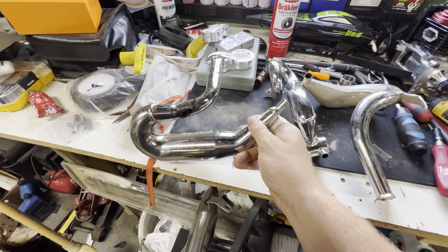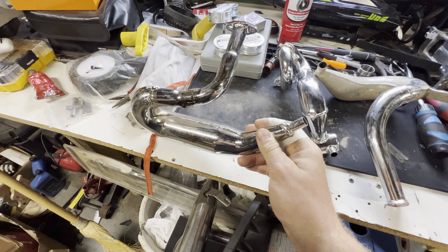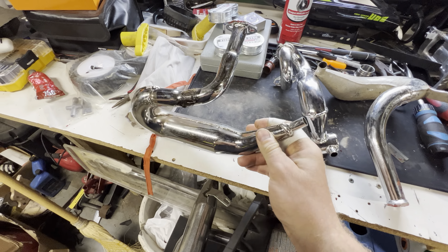With the smaller small bore engines, I like the Dominator V1. If you look at the stinger, it has a nice tight stinger on it — I feel that helps with the smaller bores. If you get this Dominator pipe, I think they sell something to raise the cage, because if not you'll end up like me with a melted cage.